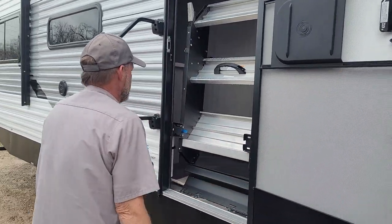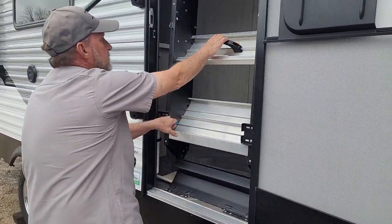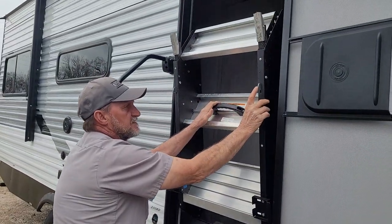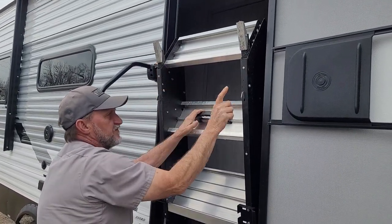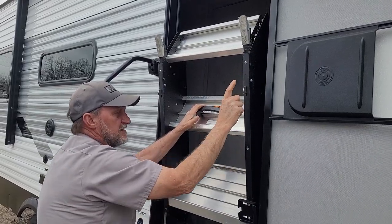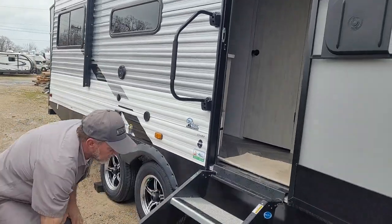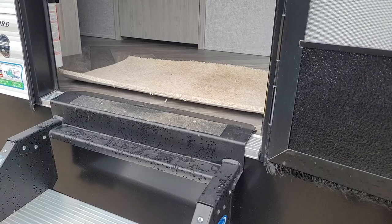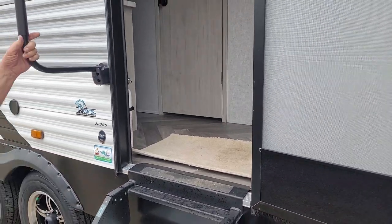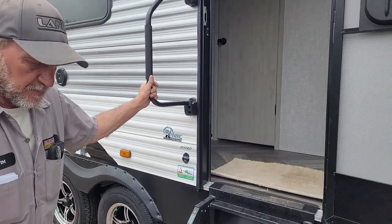Your steps are your next adjustment. Pull the blue handle — it loosens the steps from the door frame. As we pull the steps out, it has a lever on the bottom of each one of the legs that you can adjust to fit the trailer. There are 18 holes in either one of the legs. The main thing is that it has to sit flat in the threshold for the proper fit of the door over the top of it.